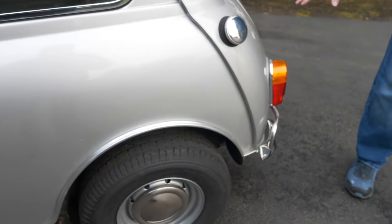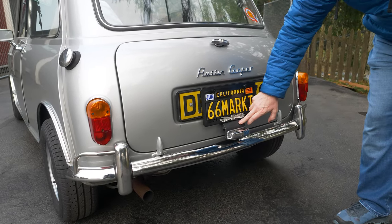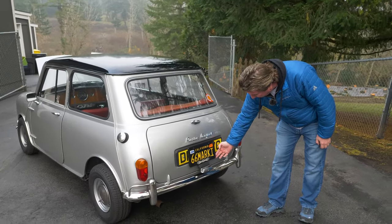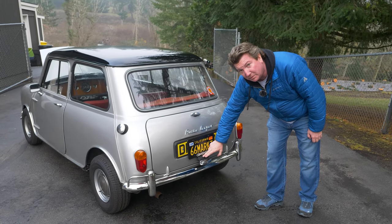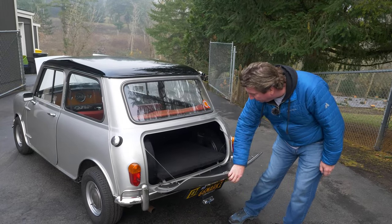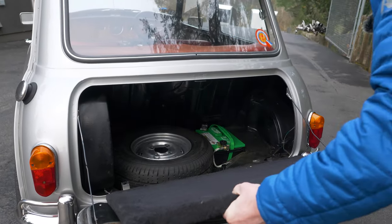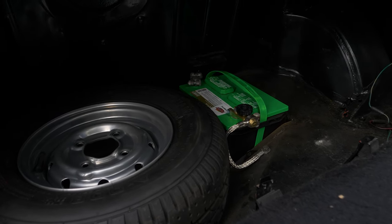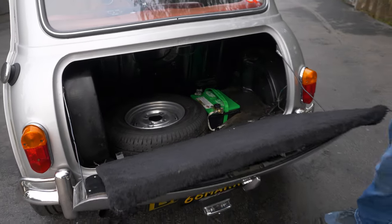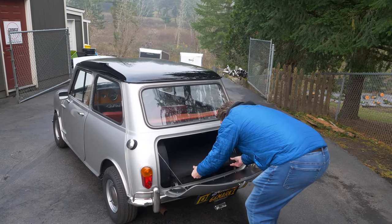Brand new rear bumper with corner bars and overriders, swinging hinged license plate with the North American license drop bracket — that's a North American-only part because the US license plate is taller than the European plate. Under the boot board we've got a new battery with a battery cutoff and a new battery ground strap, a Cooper wheel back here with a brand new Yokohama A088 tire. There's no rust on this car — this is a rust-free Mark One Mini Cooper, and that's huge.